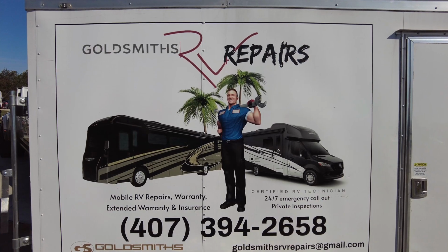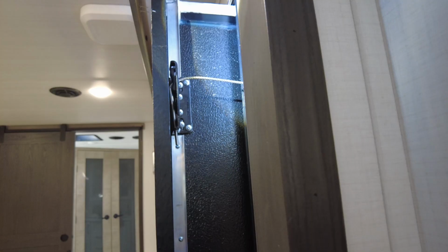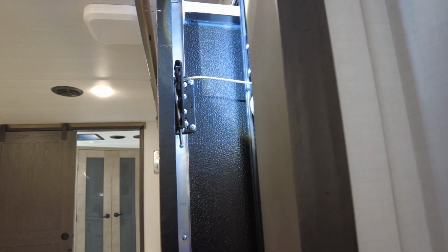They were awesome. And so there's a couple of points I want to make that I didn't make during this video. Number one is we were fortunate enough with this repair that this particular slide out, it happened on the end of the slide out that we had access to with the slide in. In a lot of cases with these smaller slide boxes like bed slides, dresser slides, things like that, there's going to be a wall on each side. With us having that access, he didn't have to take all the fascia off to get to it.